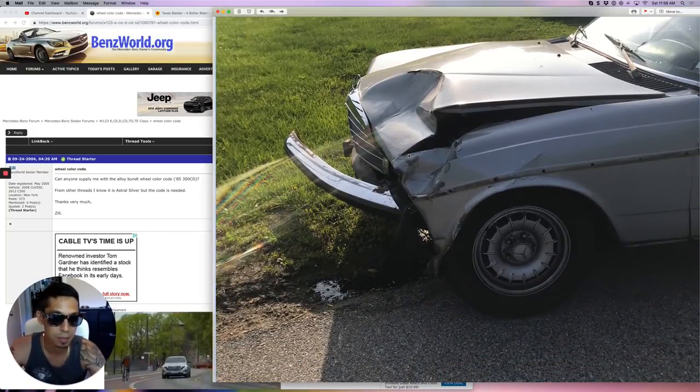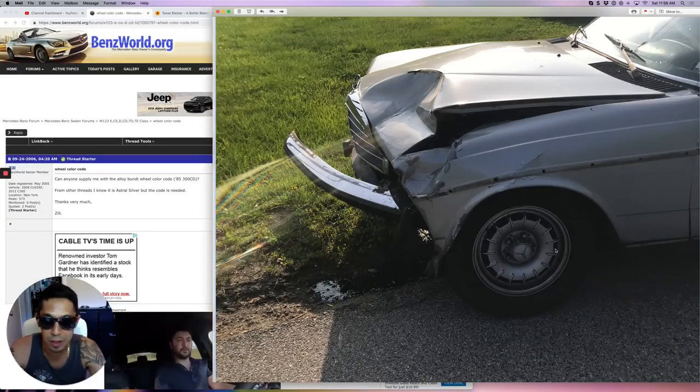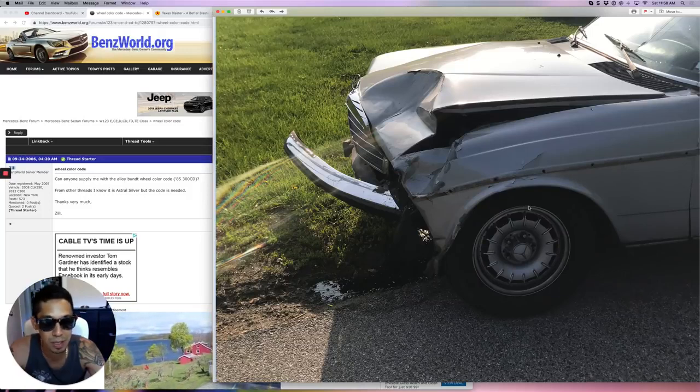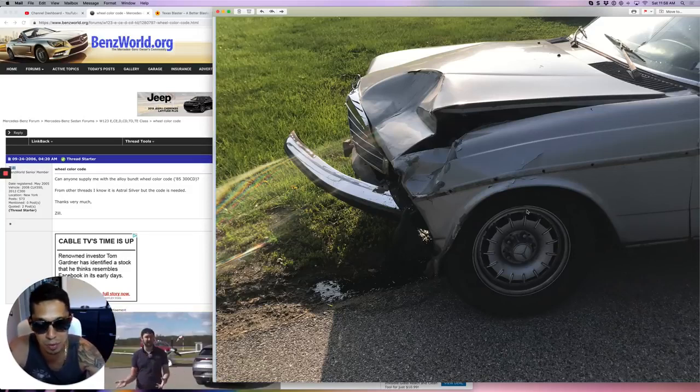I would think media blasting would be the cleanest and easiest way for you to get these rims down to aluminum. Then you could use epoxy primer over the aluminum. Okay, sand that down and you could paint over the epoxy primer. I wouldn't make it too thick because it will give you more chance of chipping if you make the paint too thick. So I would do the epoxy primer, sand that down smooth, and then spray your color.